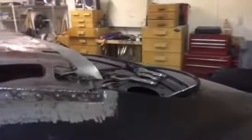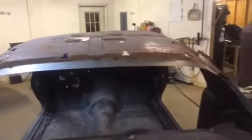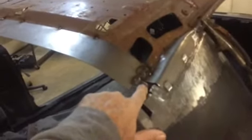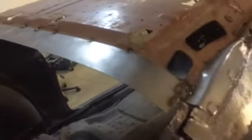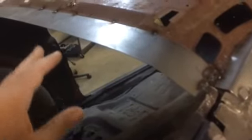Alright tubers, bringing you back. We've come along and done a little initial cleanup on this side. We cut a filler piece across the back and just tacked it in. We've got our curves down to the area of the windshield that we know is correct, but we're still not a hundred percent sure on this bend in this area — all the way across, to be a matter of fact. The plan is to let the roof skin kind of dictate where that's going to be — that's why we just spotted across there in a few spots. We'll lay the roof skin on and see how it looks.